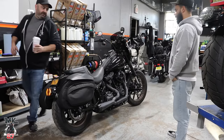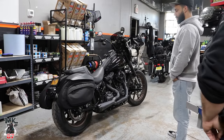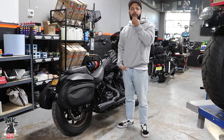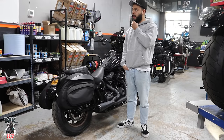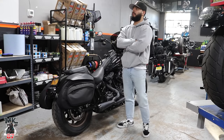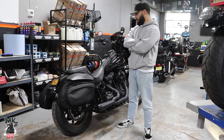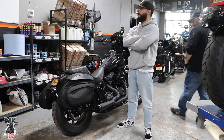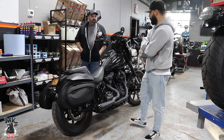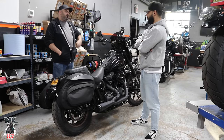Keep in mind it's got to be tuned — that'll be done tomorrow. Still a little bit of road left; you still got to ride it nice and easy. I'm going to set you at 4,250 RPM. So like I told you before, you've got to not stay at a solid RPM. You can see what power it has — you can open it wide up if you'd like, but don't do that all the time. Don't do wheelies either — not yet. The rev limit is going to be on until 1,000 miles, then we'll see who gets there first, you or Sal.